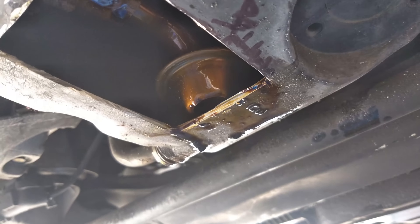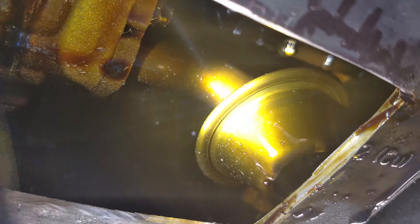The good news after doing this was that the oil pickup tube was the issue. You can see here how clogged it is — the oil is just barely dripping out. So that was the issue the car was having.